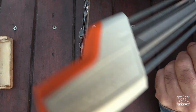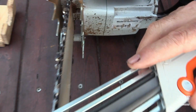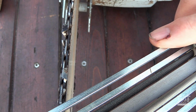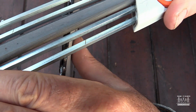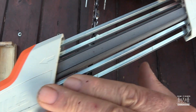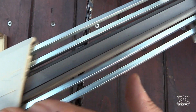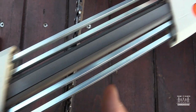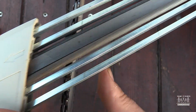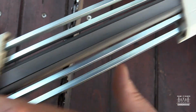one of those is my, I don't know if I'm getting to, right here. Yeah, I think that's, yeah. In fact, I can see because the little depth gauge is filed off on the top, so yeah, I know for sure that's, I think I'm going to use a red felt on it next time because the black chain is a little bit dirty. It's hard to distinguish that, although with this thing, actually I guess you don't really need a marker on the chain because it leaves a little bit of a filing mark on the depth gauges from this middle thing, eh? So you can tell for sure that you're at the beginning when you do that.